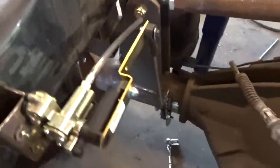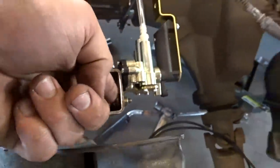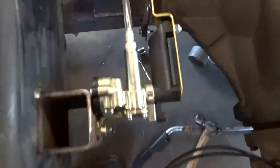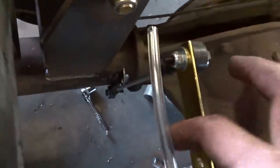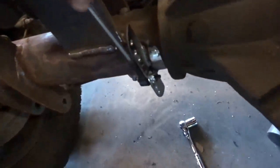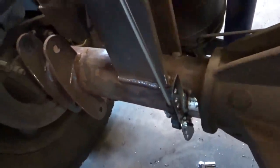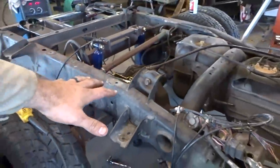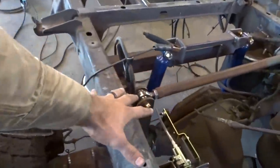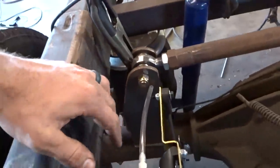So I got this leveling valve in here on just a piece of two-inch tube. Got some bolts tacked through the back side there to get it off the frame, and this here is just the relief air on it. Got a multiple-position bracket in case I want to change it up or down - just drilled a bunch of holes in that piece. This is about where it's going to ride more or less - that's where I got it set at right now, just like it is.